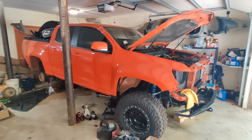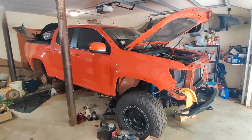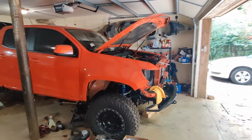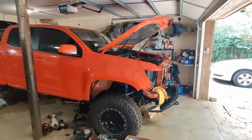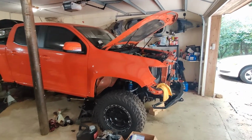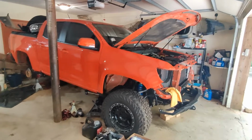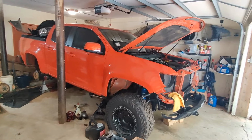So as of right now, we're still not moving. I don't know if I covered this in the last video, but I have a start tune, but my tuner wants me to give him some logs to tweak the idle before I go driving it around. So I can't do that until I have an exhaust because I need the O2s hooked up so that I can pull the data. That way he can get the air fuel correct for idle at least, and then we can start driving this thing.